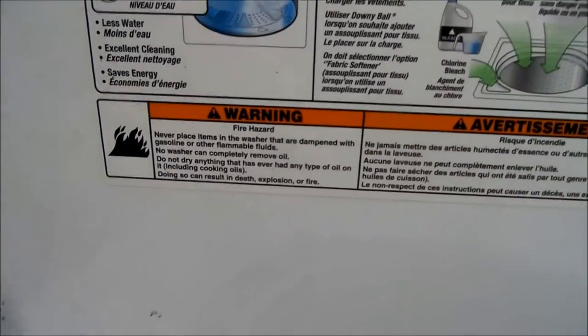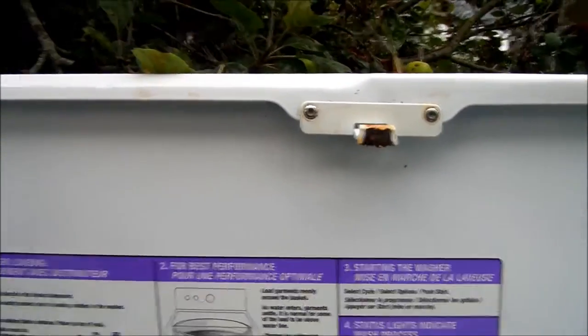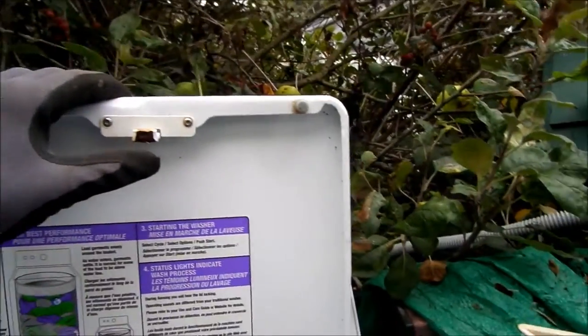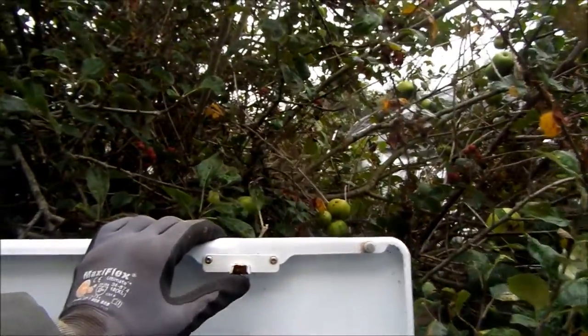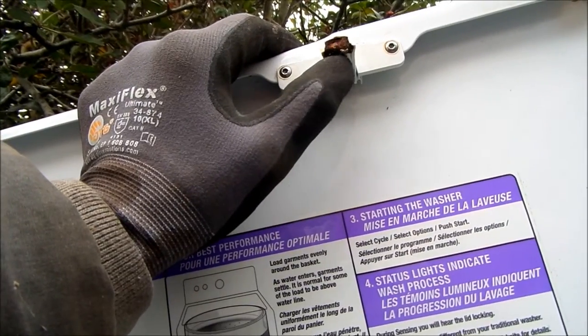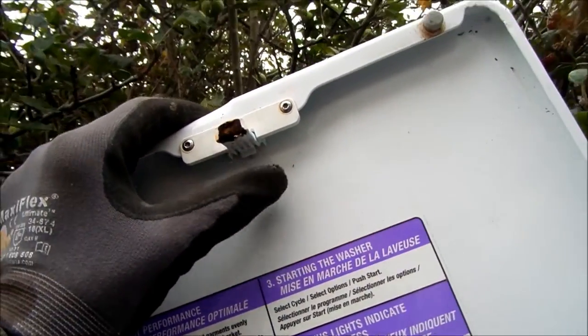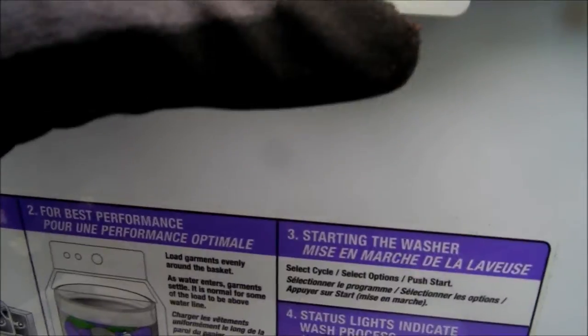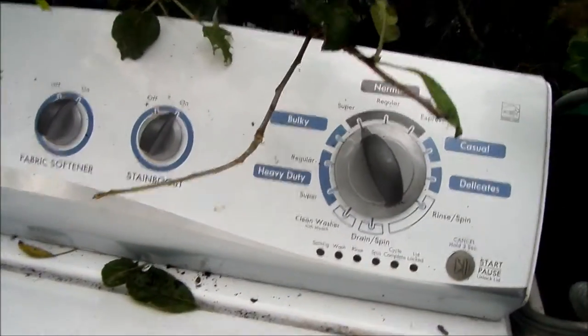Okay, so this lid switch actually started rusting. It was rusting, and the rust was actually part of the reason why it was stuck. And so apparently this piece of metal here on this tang is needed to have the switch work properly. It's an electromagnetic switch, I believe, that senses this, which may be a magnet. It senses it and tells the machine to go on.